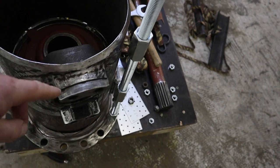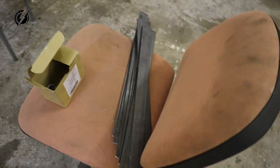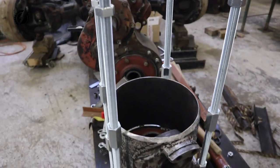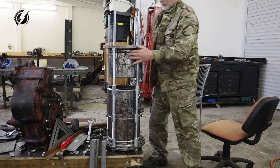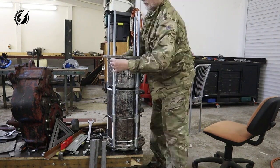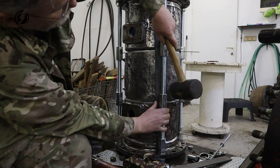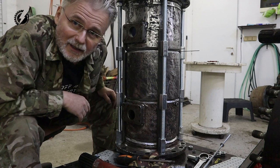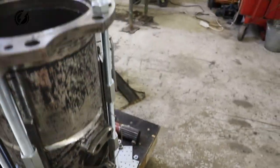So guys, it wasn't the last attempt because this tube is not perfectly round. When they welded this part over here, the material moves a little bit this way, so every distance everywhere is different. We are going to put this flat iron over here against these nuts — I have to buy a little bit extra. It looks a little bit better, but this is difficult. Take a look at that — this line is nowhere close to where it should be. The gaps over here are different everywhere. I will try to make some miracles over here, we'll see what we can do.